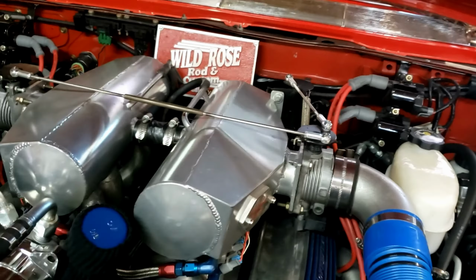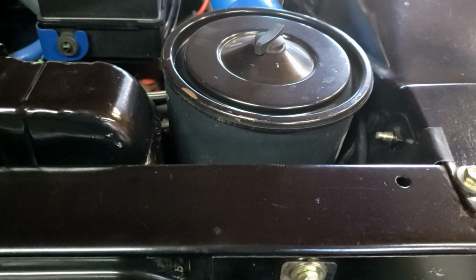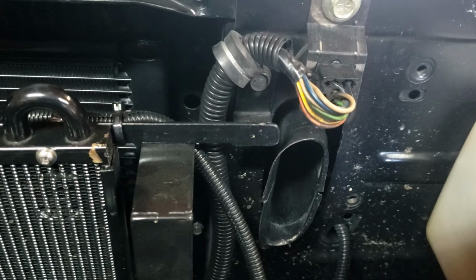it off. So for those throttle bodies to get air to them, I'm using Pontiac Sunbird air cleaners up here, and the snorkel's right down there. There's one there, comes through, so it's like ram air. One there. And you notice I cut one of them off, flipped it around so there'd be a left and a right. And gives me nice ram air, cool air.